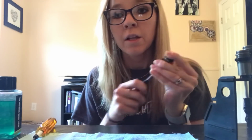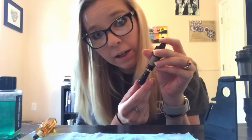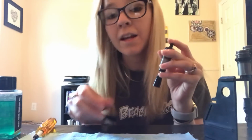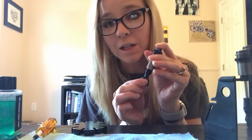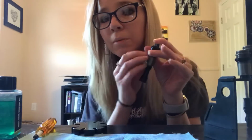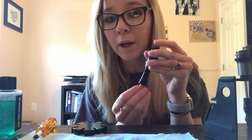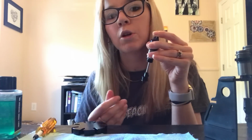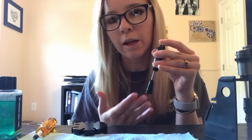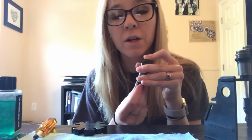So you can see rebound, when I push my shock in, is how much the shock shaft comes out, and you could see it kind of came out there a little bit. That's how much rebound I set. If you had a dead shock, when I push the shock in, it wouldn't come out at all. That's called a dead shock. I set my rebound though at 6mm, so that's why you see it coming out a little bit. And then if you had a shock with a lot of rebound, what I was talking about earlier is if you push your shock shaft in, it would want to come immediately out once you let it go. Obviously mine's not doing that because that's not how I set my shock, but that would be an example of a shock with a lot of rebound.